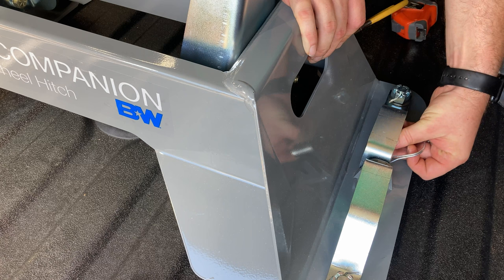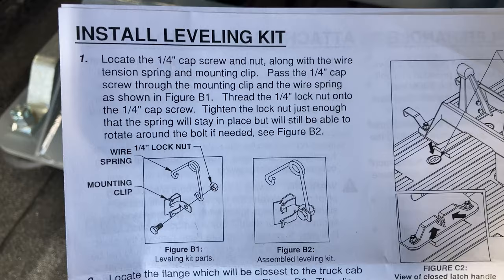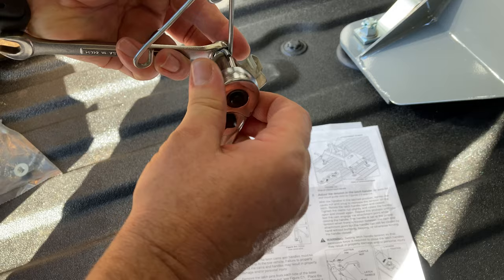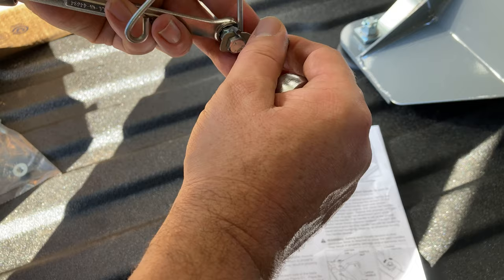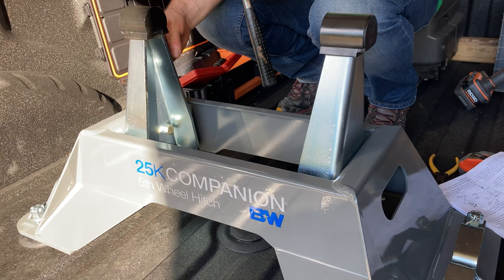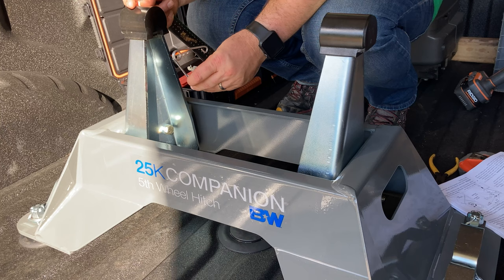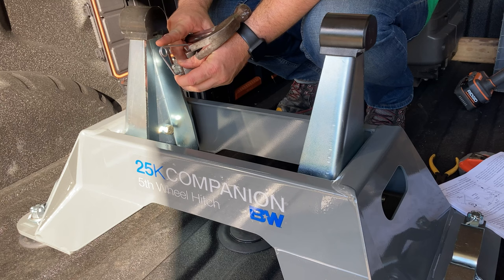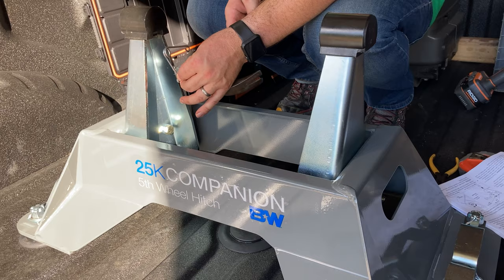Put our safety pin back through these handles. Next thing we want to do is install the leveling kit. Just like it shows in the instructions, we want it to line up like this — loose enough that the spring can still rotate around, but tight enough that it's not going to fall off. On the driver's side of the truck we now have our clip tightened on with that bolt, and we want to tap this on so that there's about a half inch of space between the top rubber piece and this — somewhere right about here.